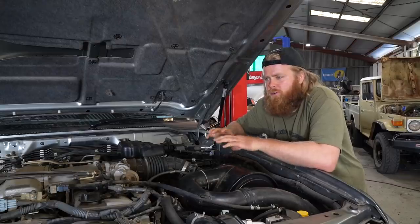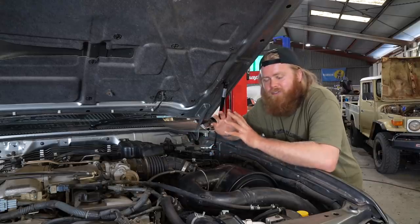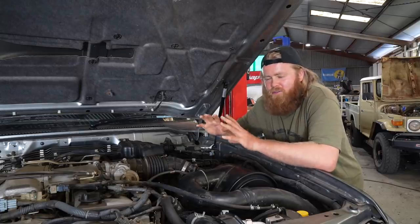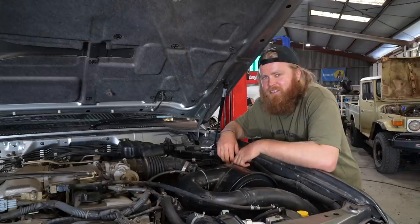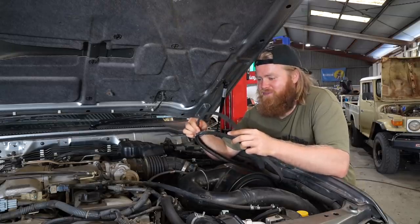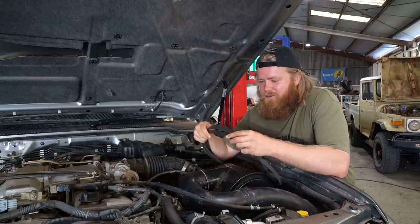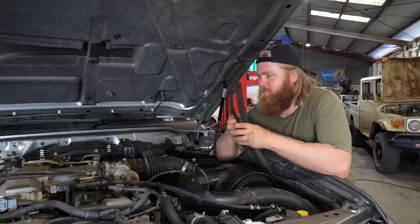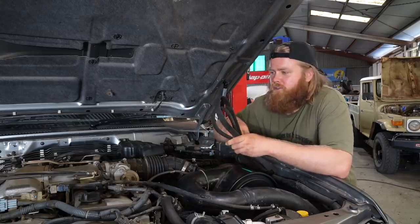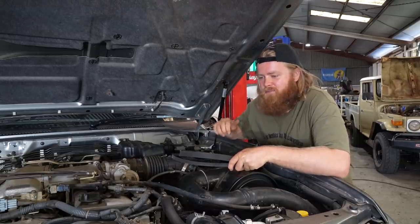Pat's working his way through it all. Some of this stuff we're changing is not completely worn out or wrecked, but I'd rather just spend a few hundred bucks now to change and refresh everything rather than having something let go out on the tracks in the middle of nowhere — because that's when it really costs you a lot. These belts weren't completely wrecked, but they're the factory original ones, fairly old, and you can see there's a little bit of cracking starting. Best to just get rid of them, put fresh ones in, and keep the old ones in the back as spares. Same with the spark plugs — they were still in decent condition, but may as well freshen it all up. Happy about doing all this and I'll feel much better now that it's been fully checked over and freshened up when I'm out in the bush.